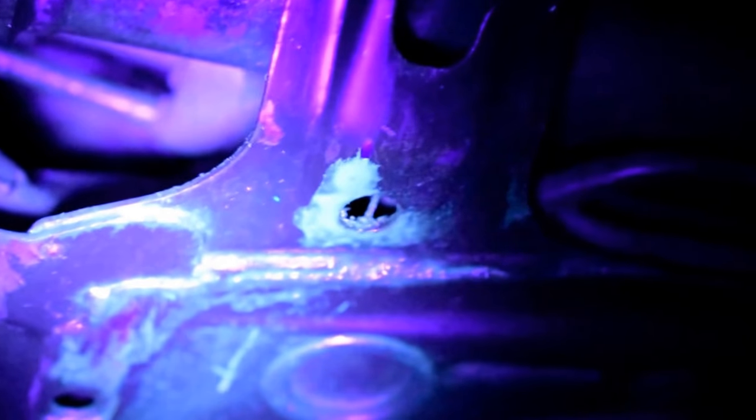I am now starting to think that the leak may actually be in the CPS area. You can see a pretty obvious leak right there — that is the very bottom. If we go further up, you can see a pretty obvious leak on the bottom of the power steering pump. And if we keep working our way up, you can see more on the underside of the water pump there.